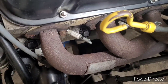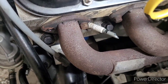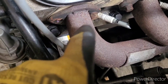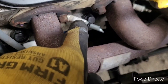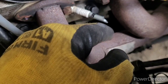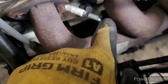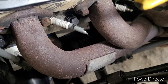Well, that explains quite a bit. The other day, off camera, we had another misfire. This number 5 cylinder wasn't firing correctly. I just realized that when I took the spark plug wire off, the clip was broken. I put the thermometer on this cylinder and it was dead, and I actually watched the spark plug wire slowly back itself off the spark plug as the engine was idling. But I didn't let it pop all the way off, so I didn't see this. I stuck it back on there and the cylinder started firing again, but we've had an intermittent misfire. This would explain a lot. The spark plug wire is broken, so we'll need a new spark plug wire.